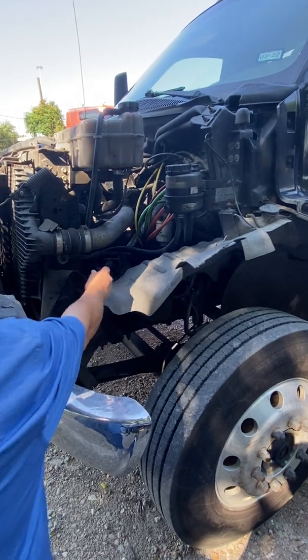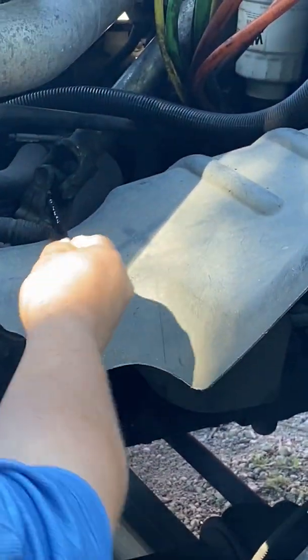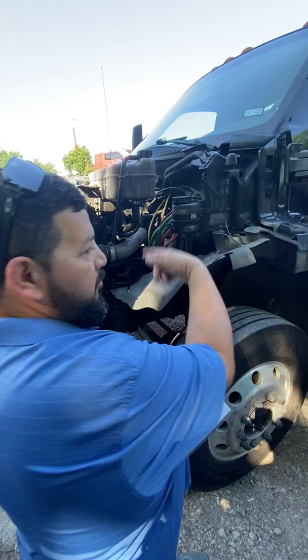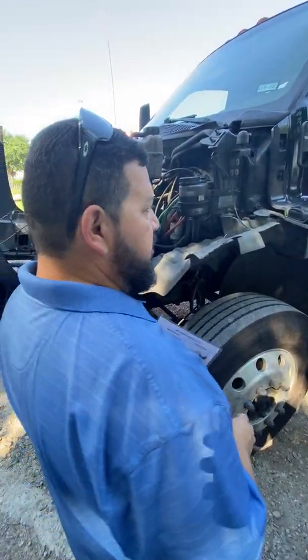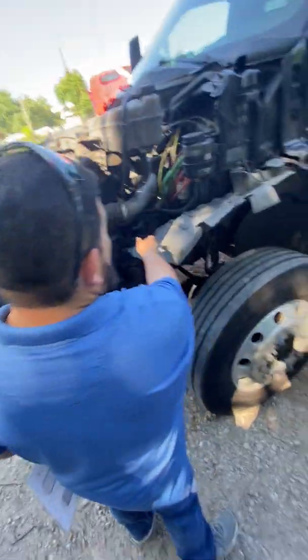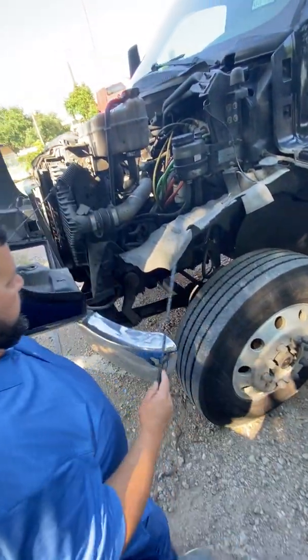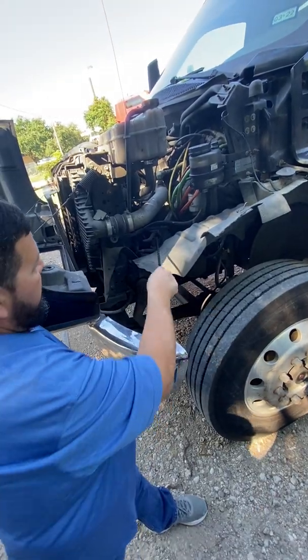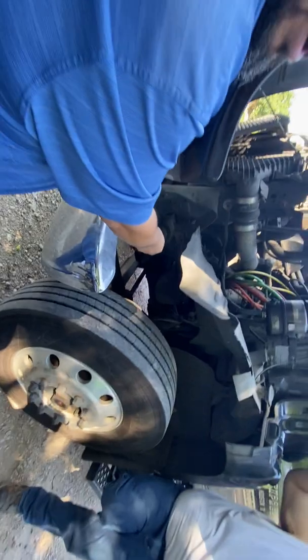so it doesn't wear out as it's turning, because you're turning it back and forth. And this area around the U-joint, these holes that you see on both sides of it, we have to make sure that they're clean of debris and that nothing is stuck in there, because if something gets stuck in there, like this stick, or a rock, anything, we're not going to be able to turn it right or left. It can jam it up so you won't be able to turn it. Always make sure those areas are clean. So the steering column, the U-joint, and now this one, this is the steering box.